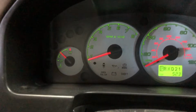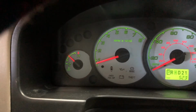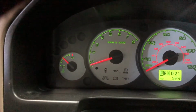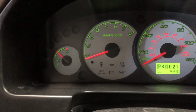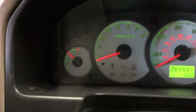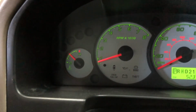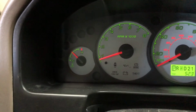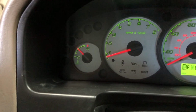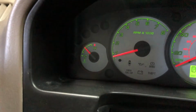It's okay to put the cap back on and do another 30-second rev cycle, and just 30-second rev, 30-second idle, 30-second rev. And when you get to the point where it's pushing out very hot heat at idle, you know you've got most of the air bubbles out. And right now I'm feeling extremely confident with this. This one burped out a little faster than normal, so I'm pretty pleased with that. The customer will be able to get her vehicle back here soon.